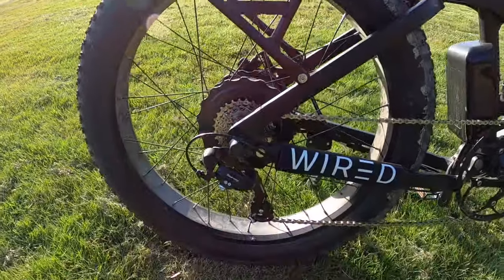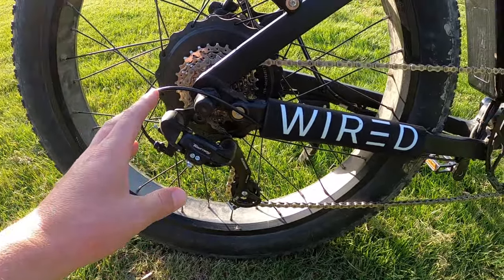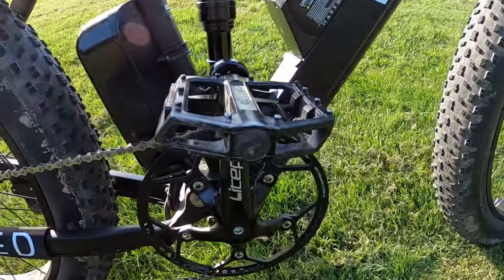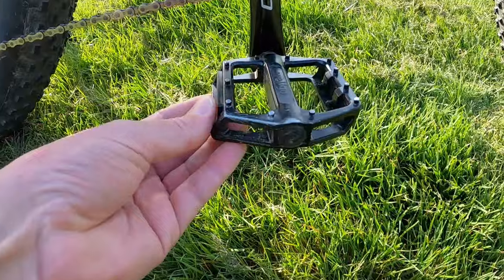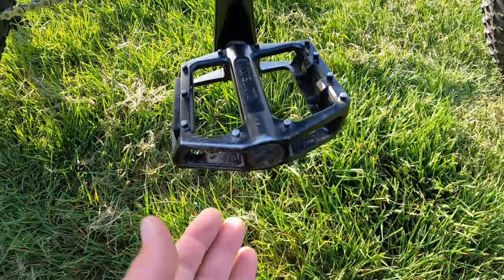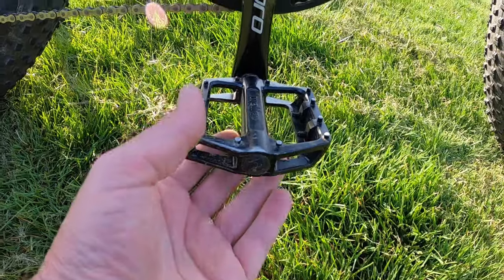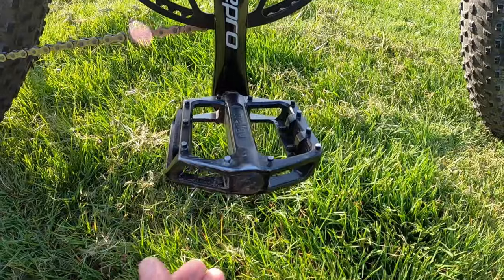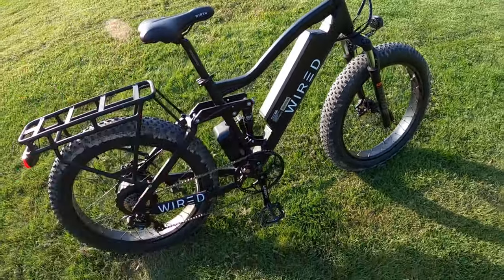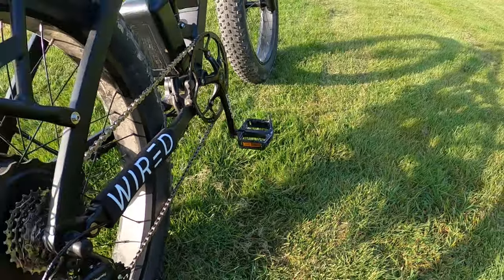There was a little bit of clicking from the seven-speed Tourney derailleur, so I had to go in and do some adjustments. I made a video about that as well. The only other issue I had was pedal strikes — getting a little bit of pedal rub on the ground when turning sharp. Because of how big this 56-tooth front chain ring is, it gets the pedal down low. With full suspension and the sag when you lean, there really isn't a ton of clearance from the pedal to the ground, so pedal strikes are possible.